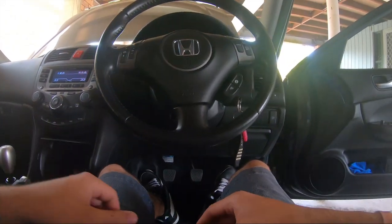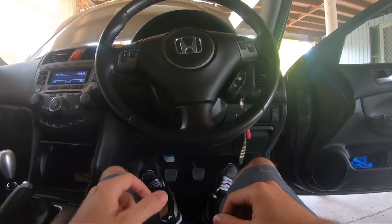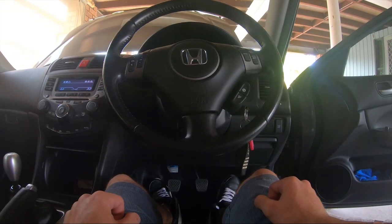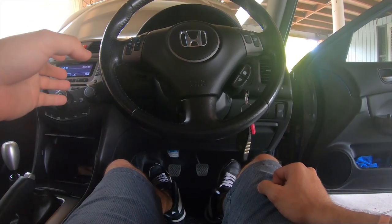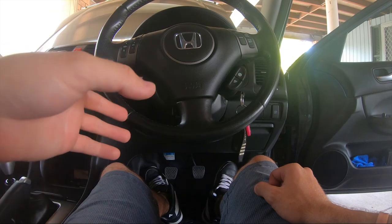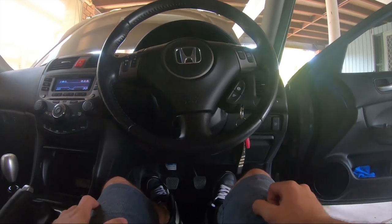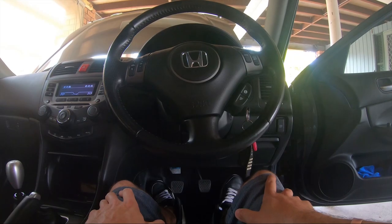So it's really important that you do this correctly. It could be argued that what I've done here is technically illegal as I've removed the side airbags from the seat, however with these snug seats I feel pretty secure — but that's my decision, you do this at your own risk. Remember to disconnect the battery before and after, make sure those resistors are in place before you reconnect the battery otherwise you will get your airbag light. But as you can see I'm nice and snug — we'll go for a test drive shortly.